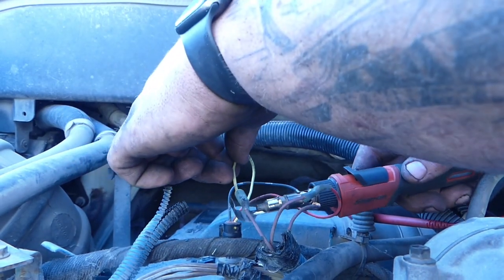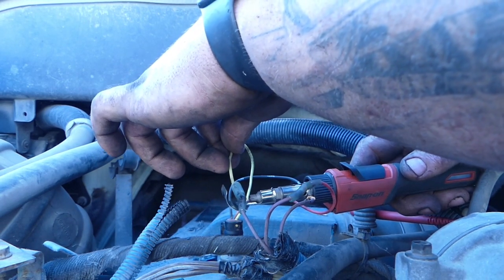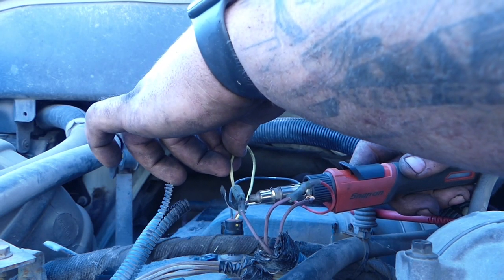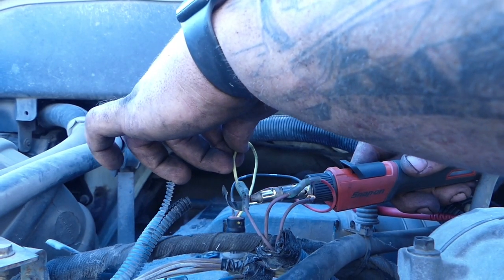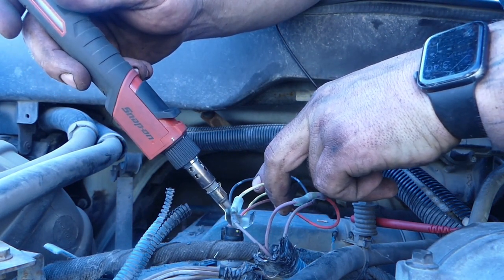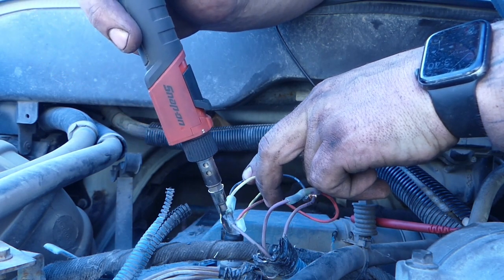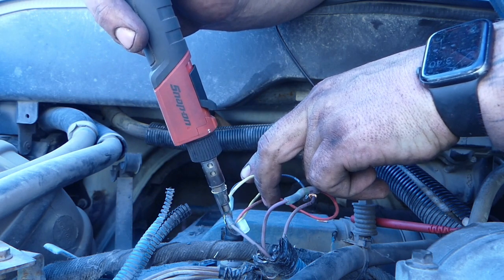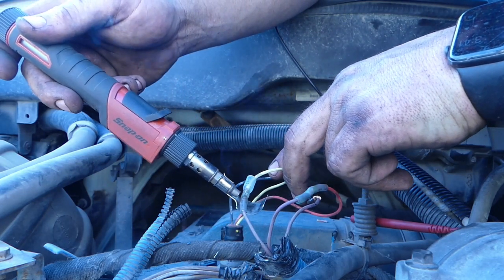I have hooked to multiple machines, Bobcats with Doosans in them, a Bobcat with a Kubota in it, another Kubota and a Takeuchi. There's been lots of machines that I've been hooking to lately. John Deeres. I've hooked to a Cat truck engine, but that's about it. I've hooked to a Cummins. There was one thing that they didn't have in Cummins for a VGT actuator, but that was on an early 6.7 in a motorhome with a CM850 ECM in it.